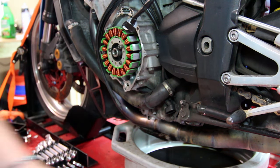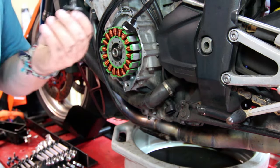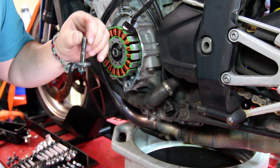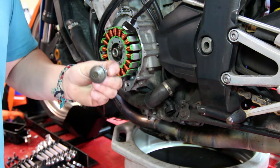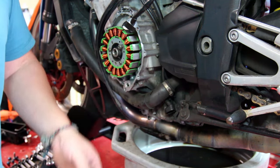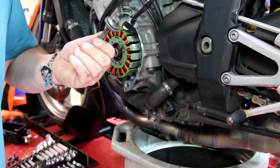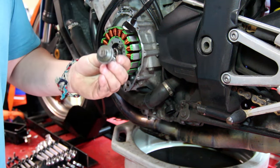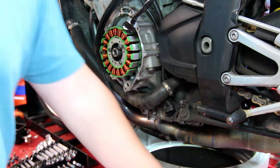just in case. Now, other piece of jankiness, I did some Googling, and it looks like this bolt right here that held the flywheel on is actually stretched to fit. So theoretically, you shouldn't reuse this. Here's my take on that. If it was a head gasket bolt, I would say, yeah, the project would sit until I could go get another one. The honest truth is, we're just going to over torque it a little bit more, stretch it a little bit more, and it'll be fine for our purposes.